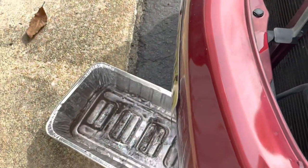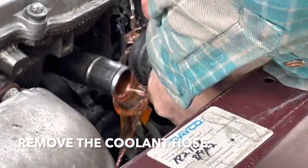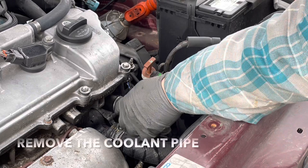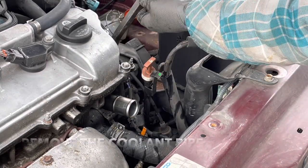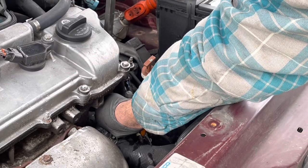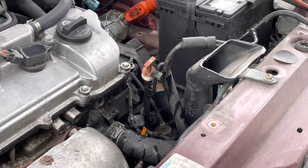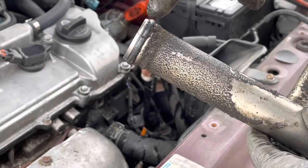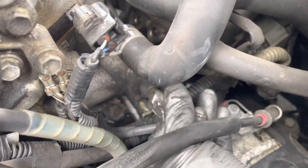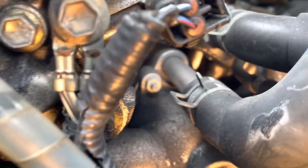Make sure you have a pan or something to catch all the coolant when it comes down. Remove the hose first. Next, pull out this tube from the housing — put a pry bar against the bracket and pull on it. You can see it has a rubber gasket. Clean this up. Then disconnect the plug just like I said — push up — and the wire harness is detached. Now we're ready to remove the 10 millimeter nuts.